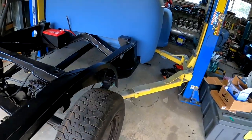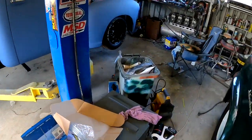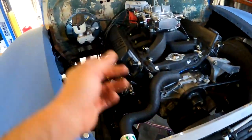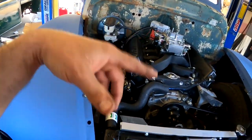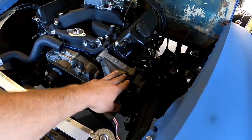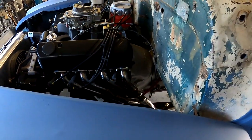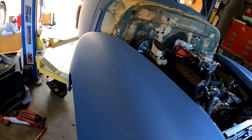That's the next day. What I got done yesterday was I got the power cables made and ran them, got the transmission oil cooler lines made and run through the transmission. Got the intake manifold bolted down — the bolts supplied were too long, but it's bolted down and sealed up. Made and fitted the ignition lead, just got the alternator hung, fan belt's correct. Went to town this morning, got some more supplies — radiator hoses, thermostat housing, and yeah, brakes and the wiring.